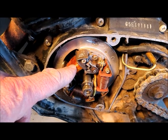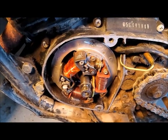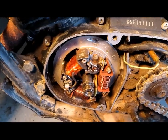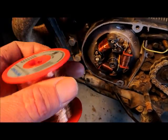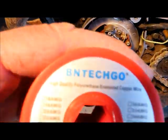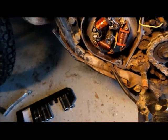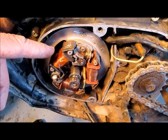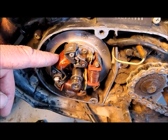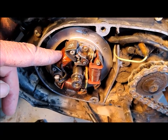This is speaker wire — actually called enameled copper wire — used for making speakers or any kind of coil. It has insulation bonded to the outside; you can't see it but it still looks like copper wire. It's 24 gauge, the same gauge as what was originally on the bike, and it was 20 bucks. I pulled off a section about the same length as the original, tested the resistance — it was a little high, like 1.8 or so. So I kept cutting pieces off until I hit 1.3, which is nominal. 1.0 is low, 1.6 is high — I cut it right down to 1.3.